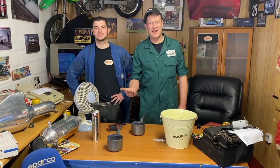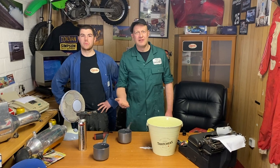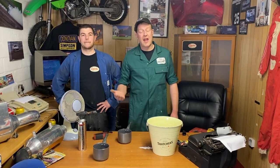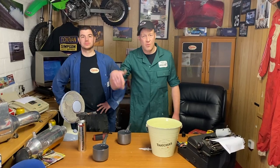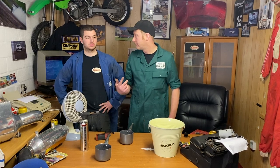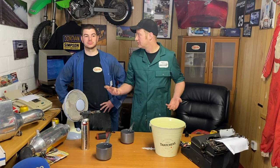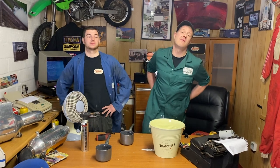The simple way to put this is, you stick your hand in the toaster. Make yourself a pan toasty. There's two things you want to do. If your toaster's out in the garden, you run around waving it. If you're in the kitchen, you turn the tap on, don't you? You stick your hand under the tap. So, yes, air-to-air cooling does work. You burn your finger, you wave it. But if there's a tap there, you will go for that tap before you go for a wave. That's why we run a charge cooler.